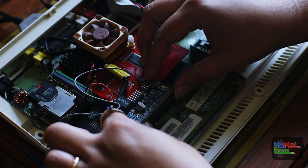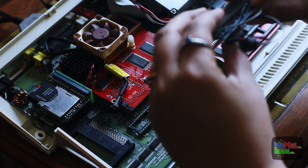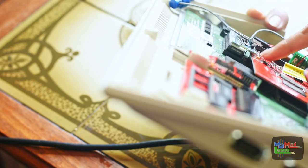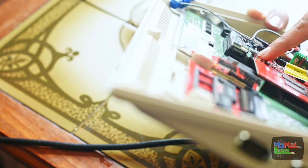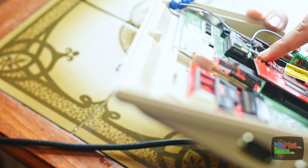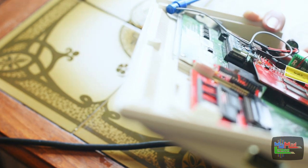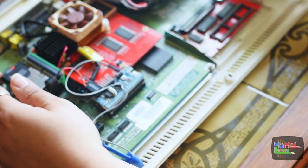Got to be careful here because there are pins here and I don't want them to short on that board. So let's get some insulation — as you can see there's just enough clearance and there are no pads or points touching each other. However the boards are very close, so I'm going to put some electrical tape on the board just to have some insulation just in case it gets pressed down.